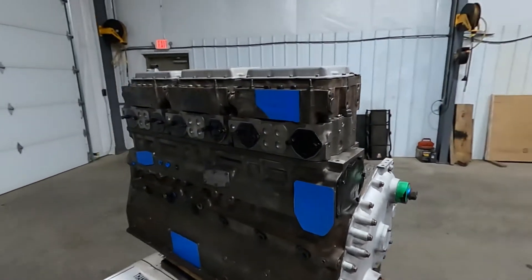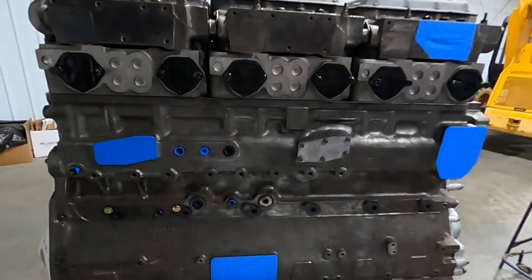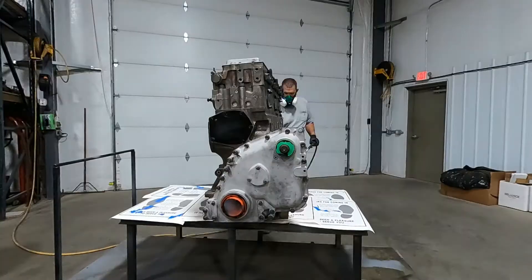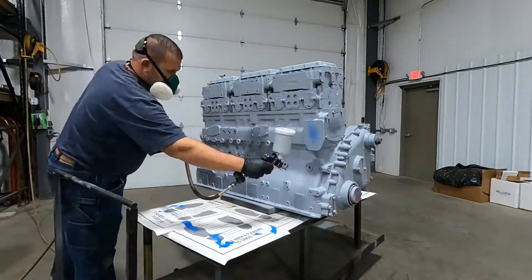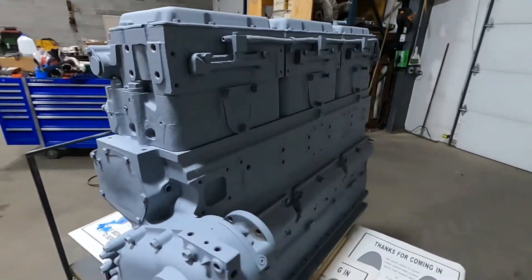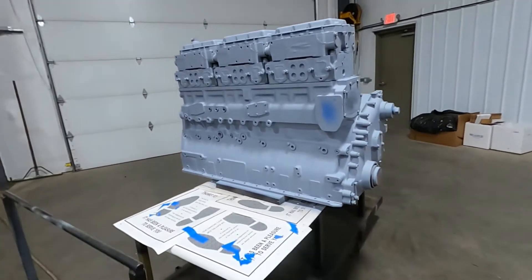Here's what it looks like when we're ready for the first coat of primer. Some of the surface areas we've got taped up, others we've got gaskets taped over and bolted on. All of the holes in the block that need plugs or fittings have got soft plugs put in them — every surface area is covered up. We're done with primer coats and about ready to spray the first coat of black on it. We'll put this back on time-lapse and start with the black paint.